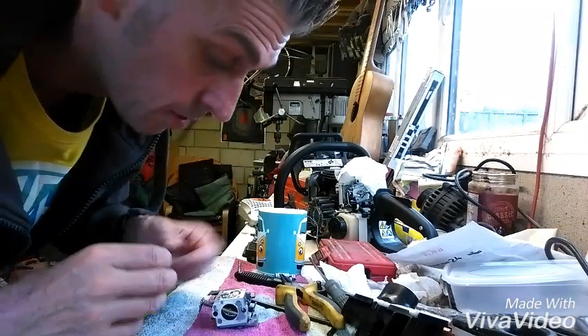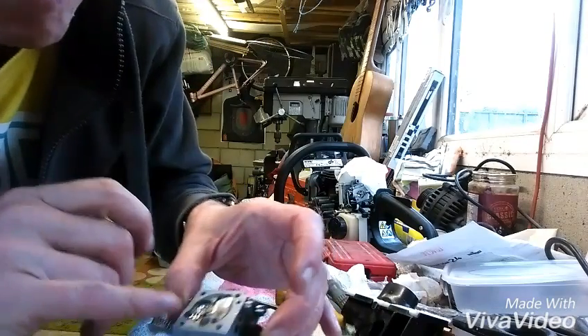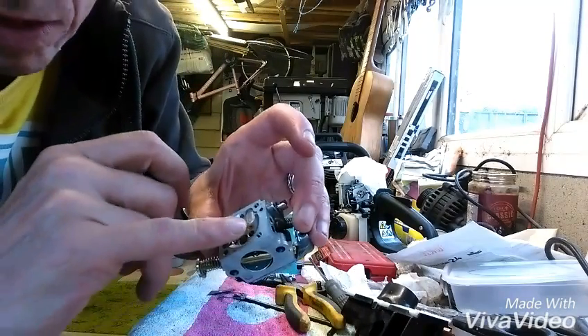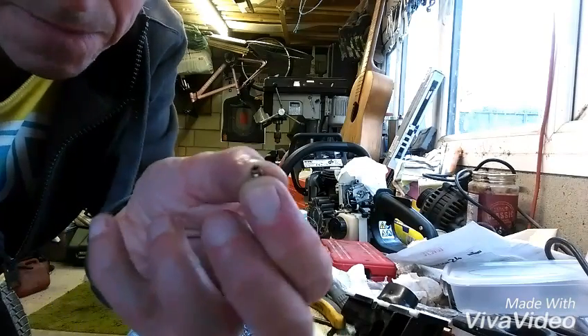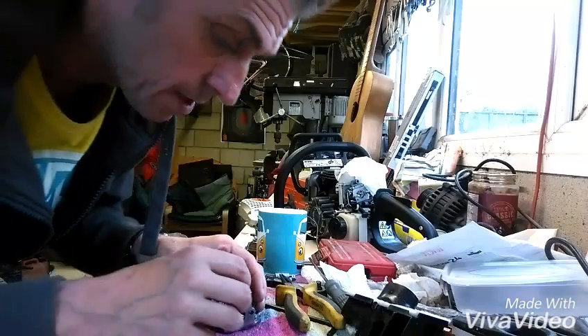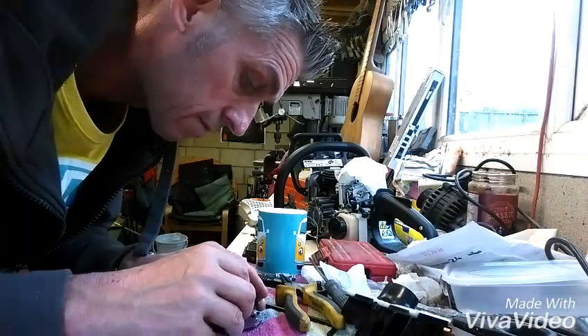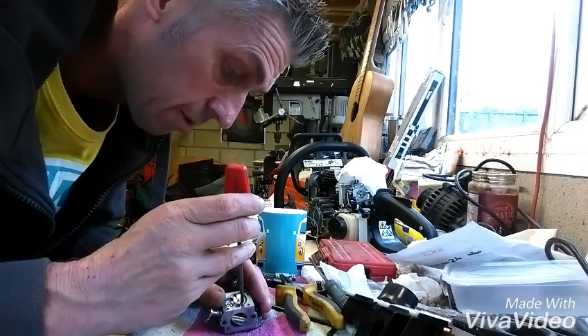So we almost had a major cock-up then. Before I put this side in, over here there's a tiny hole here as well. I took the throttle jet out as well to clean it - it's that one there. You should be able to see through it. So that carefully goes in there as well, because it wouldn't have run well without that.